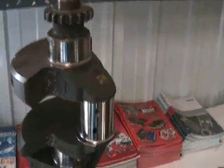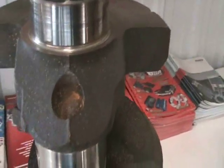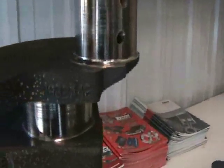Here is your typical cast General Motors 350 crankshaft. As you can see, you've got a very fine pointed casting line here — that represents that it's a cast crank. See how it's real fine and defined. You can also see the part number, which is 3932442, signifying that it's a stock 350 crankshaft. A simple online search will tell you all the information you need to know about these cranks.